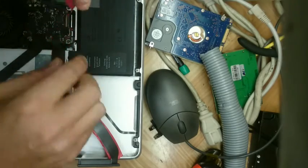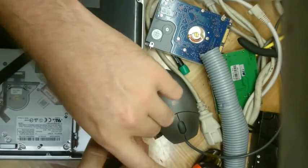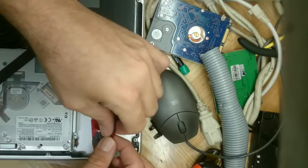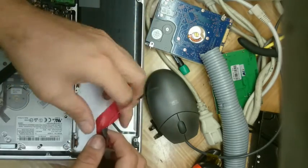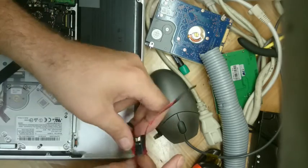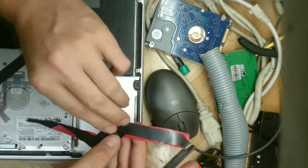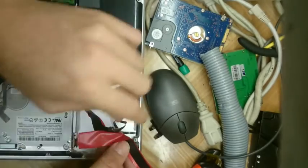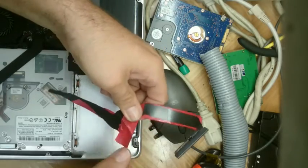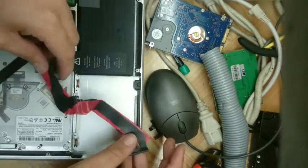What this does is insulate the cable from the aluminium bodywork. SATA signals are a differential signal, so data is sent and received on separate pairs, equal but opposite on each pair. Your send wires have two signals that are identical but inverted, and they reference each other. If the cable wears through, it can short out one of these wires — just one — and that'll cause issues with the drive, such as being unable to write, or data getting corrupted as it passes through.